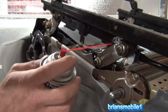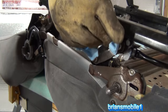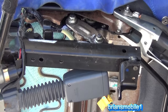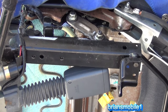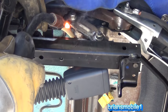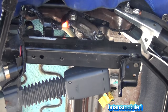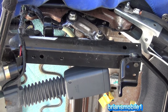I've basically cleaned this out so that I can weld to it. I'm going to take a little paper towel and use some brake cleaner — probably should have cleaned it before grinding, as it probably spread contaminants — but I'm going to glob the weld in there to the point where it's probably not going to matter. I've cleverly disguised the chair as a welding jacket, just trying to protect the upholstery. I'm doing this over the cement. So I've got this all cleaned up. I just need to hood down and tack it. What I'm doing is trying to weld like a buttress between the two pieces — there's a big gap, so I start at the base, go up and then back, building it like I'm making a spider web.